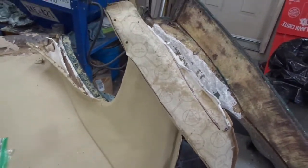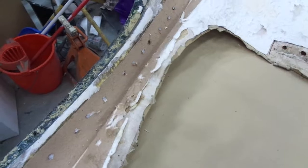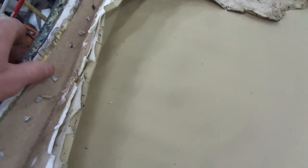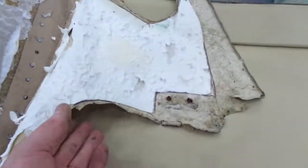Peeling off these side panels — it's tacked here, so that has to be replicated. Heck of a mess. This is the left-hand side panel peeled back. These are upholstery tacks. It's apparent that I first attached the vinyl to the top side of this, then glued it on, then tacked it, then glued as I went along. Put a welt on the side, and put some foam here first, then worked it around.